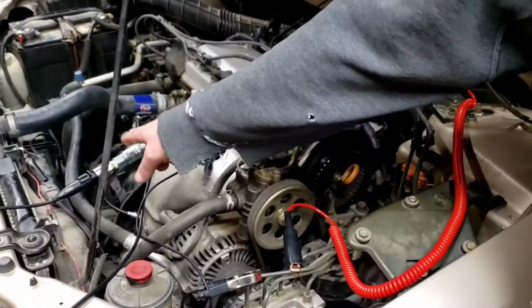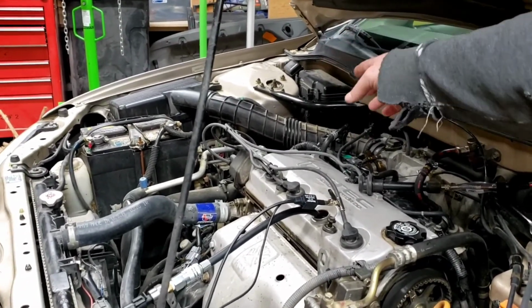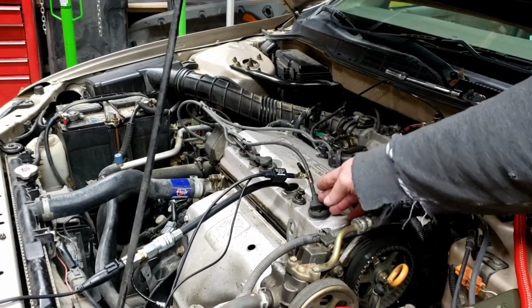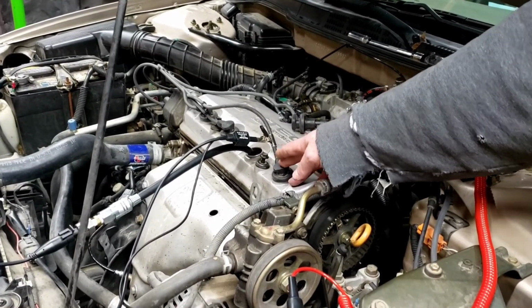Same thing. We got the pressure transducer hooked up, but this time, instead of off the distributor with the signal wire, when the magnetic field collapses and sparks, we're doing secondary ignition right off the plug wire. Should get the same results, maybe a little more accurate, but we're probably going to get around 6, 7, 8 degrees advanced, which I'm imagining. So we'll go back to the scope.